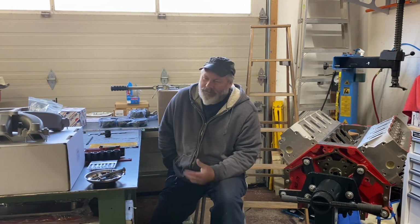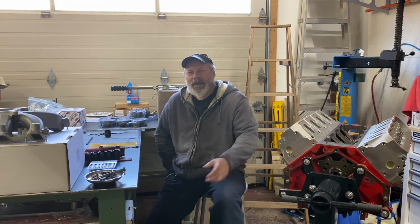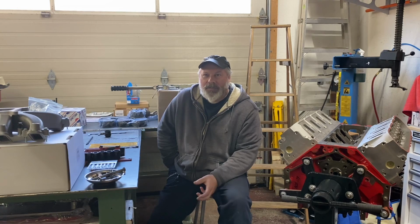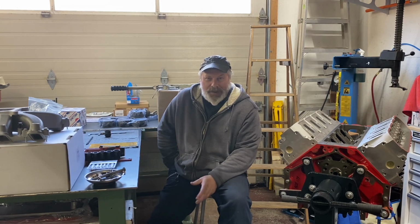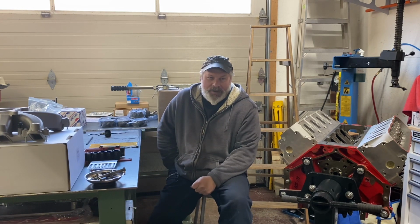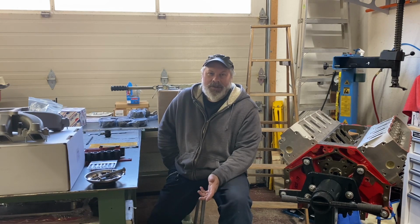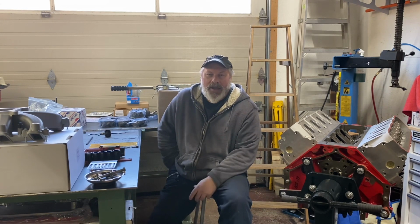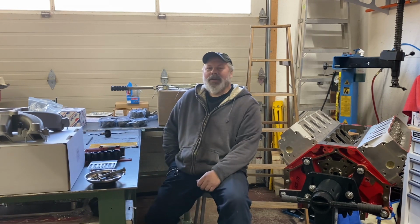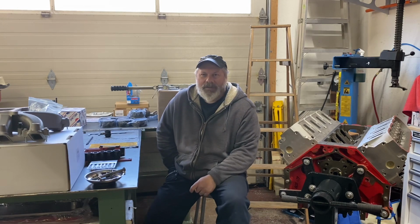But I've told the story before. The clutch I bought was an IHRA Mountain Motor Pro Stock clutch that I sent back and had rebuilt, and it was too aggressive for the motor and it would bog. I needed more power. So it was midsummer. I wanted to race the Top Sportsman Series locally, so in a crash course over 5 or 6 days, I researched, bought and installed an NOS fogger, and went from bogging and running 8.20s to 7.80s, 7.70s, and then I gave it a little more nitrous jet and went 7.50s, almost 180.